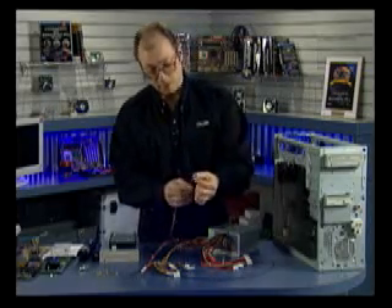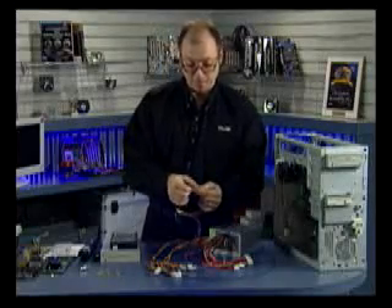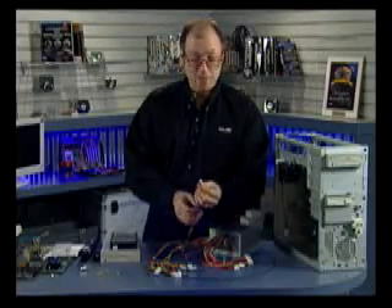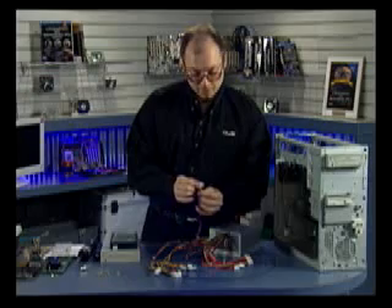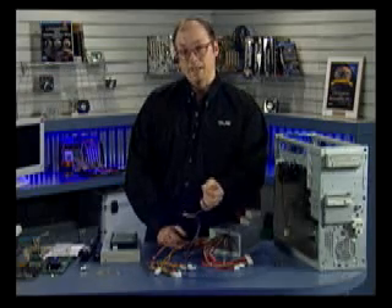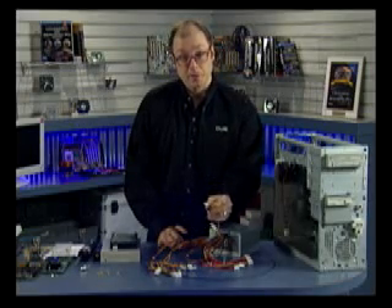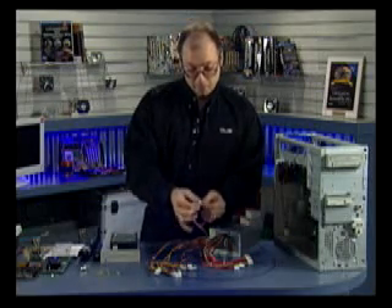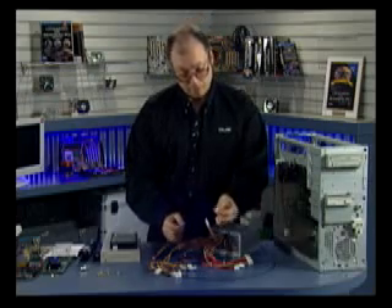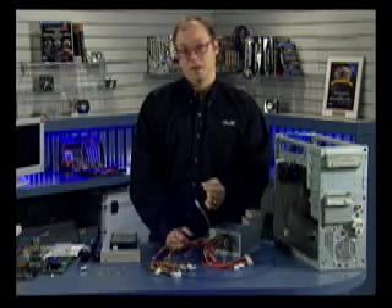It's important that you get these connectors in correctly. The larger ones are pretty foolproof, but the smaller floppy connector has been a source of trouble. I've seen at least two or three floppy drives get smoked right in front of me in my classes. Apparently the connectors are not keyed as well as they could be — it's possible to install them off one pin to the left or right, or even upside down. So make sure you put this connector on correctly. If you're unsure, check the manual. If you miss a pin or install it upside down, it won't be a very expensive mistake — floppy drives only cost about $15.